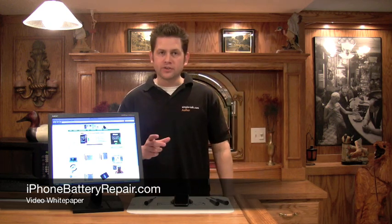Okay, let's get started. The iPhone 2G has a very tight case tolerance, which makes it difficult to remove the outer aluminum shell. We explain a couple different techniques to help with the case opening, but expect some bending and flexing in order to get the case off. The case removal is probably the most difficult part of the replacement process, so take your time and be forceful with your tools. A few other words of caution.